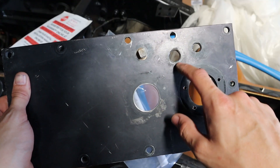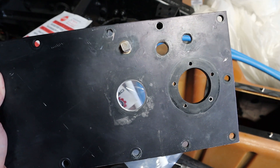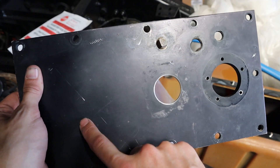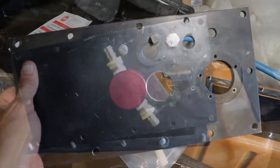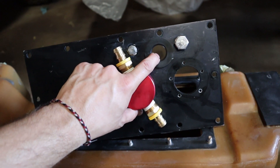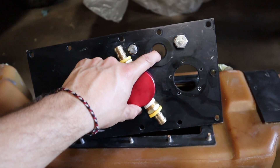Let's see if there's enough room right here to actually put our fuel tank vent line back in. If not, we'll have to find a plug for that and put the vent line back over on the other side. We went ahead and drilled out the new hole for the fuel tank vent line — that was drilled out with a 1 and 5/16 inch hole saw.